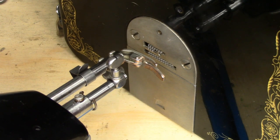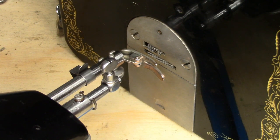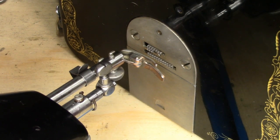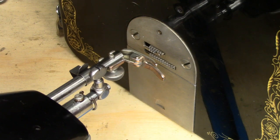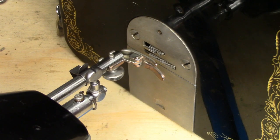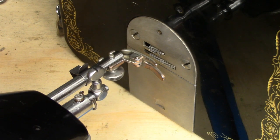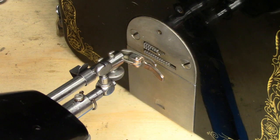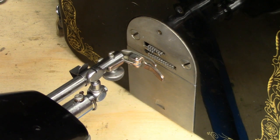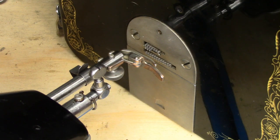You can see the feed dogs are hitting at the back of the stroke with plenty of room at the front. I'm going to turn the eccentric bolt — see how that's moving the feed dogs. Now we have good clearance at the front and the back at maximum stitch length — that's the adjustment we want. However, these feed dogs are set too high. The proper height of the feed dogs is 80% of the teeth showing through the plate when the feed dogs are at their maximum height in the middle of their stroke. This is way too high.